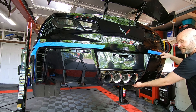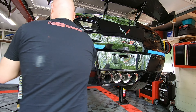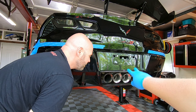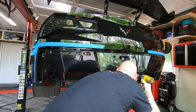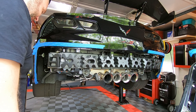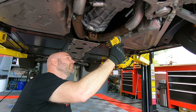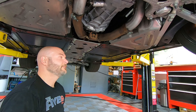It's going to sound like you're doing something wrong — that means you're doing something right. There are also two 10mm bolts up under the exhaust tips. Make life easier on yourself — follow these instructions. We're going to go ahead and unplug the NPP stuff — the baffles. We're going to go ahead and release the band clamps. You'll just jump between these two band clamps with a 15mm and that will free the axle back.